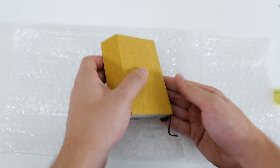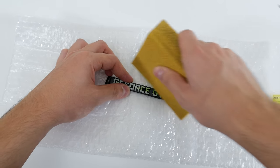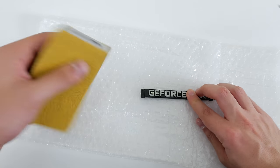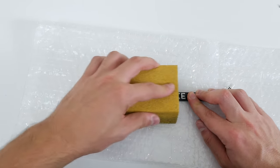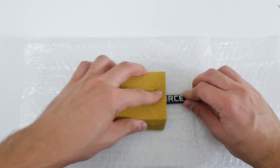Once the logo is disconnected, I got some sandpaper and started sanding off the green paint — and this is very important. Make sure you are sanding the logo off equally, so make sure to stop and check constantly. If you start seeing black spots on the logo, that means you are starting to sand off the white plastic, and you don't want that.